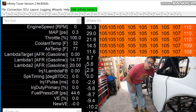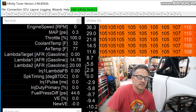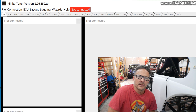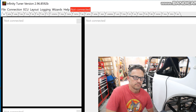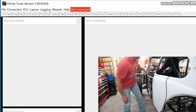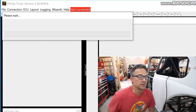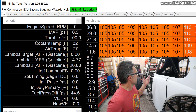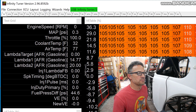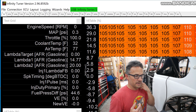Then turn off your ECU. It usually takes about five seconds to shut down. Then I usually wait about 30 seconds. Turn your ignition back on — it should identify. Everything starts up; I can hear the relay click. Up in the corner, mine says USB Infinity Series 5. Yours should be reflecting whatever firmware you uploaded on it. Hopefully everything worked for you at this point.